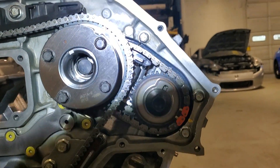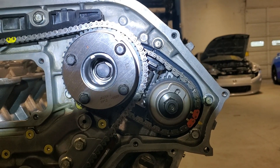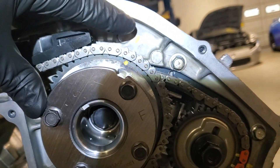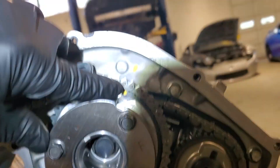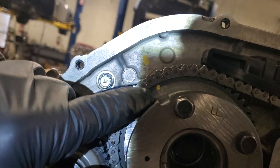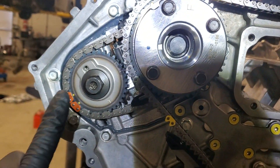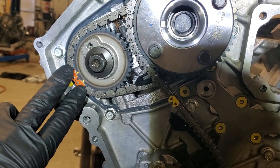Whenever you're taking apart your GTR motor off the jump, you want to go ahead and indicate, like I did, the actual factory primary chain sprocket indicators on the back of the cover, and don't accidentally wash things off. This will help you out a lot, just so that you're confident as you go through it. Over here on the passenger side, we have the two dots on the exhaust cam sprocket.